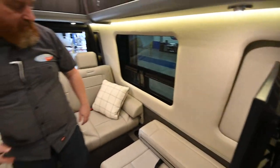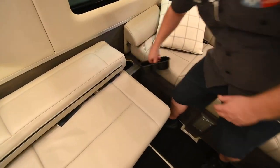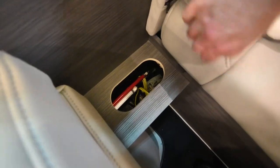The last thing back here is the low point drains — they're over here under the cup holder on the curbside, or what you might call the passenger side. You're going to see a couple of little white valves all the way down — the white valves pointed towards the driver's side are the low point drains.